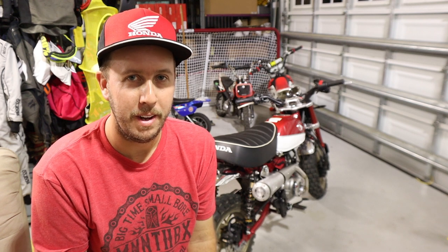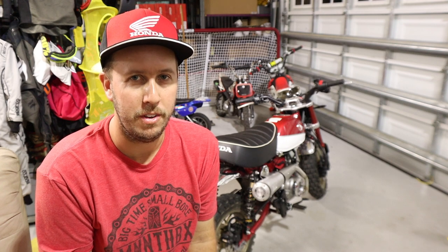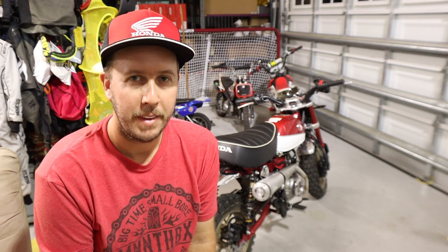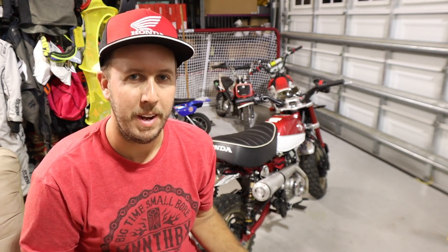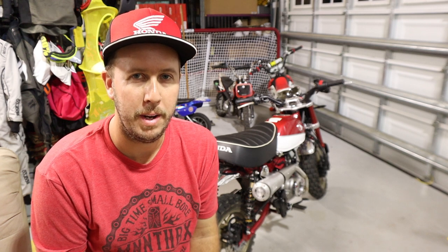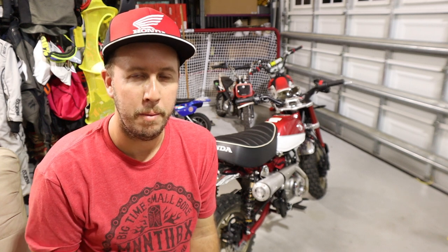and then put the whole assembly on the end cap. So you see I've used the anti-seize compound pretty liberally, and it is kind of messy, but I would definitely recommend using that. And you see I thought it was such a good idea I used it on the head studs and even on the heat shield mount bolts too, because anytime you have exhaust and screws and the expansion and contraction from heating and cooling, with dissimilar metals, it maybe makes those things kind of hard to get out sometime in the future. So anti-seize compound's a nice touch to have in that kit. It's not something any of the other exhausts came with, but it's probably a good idea.